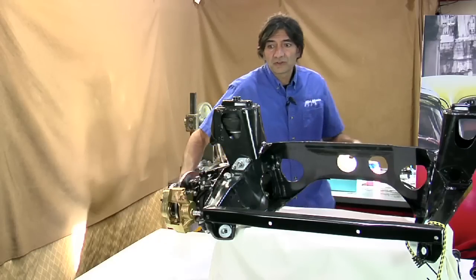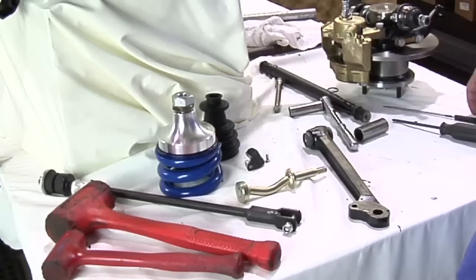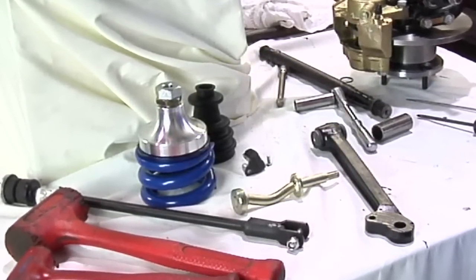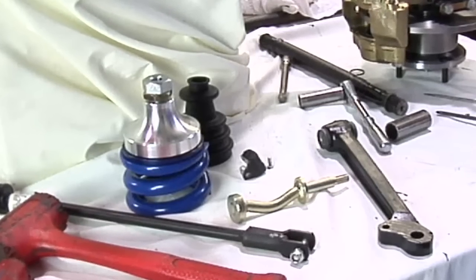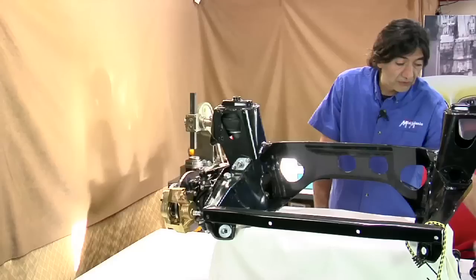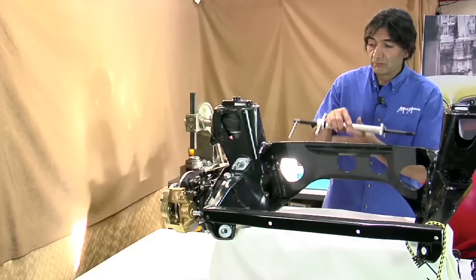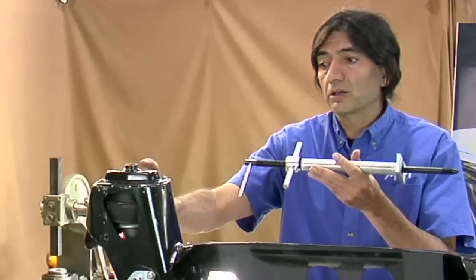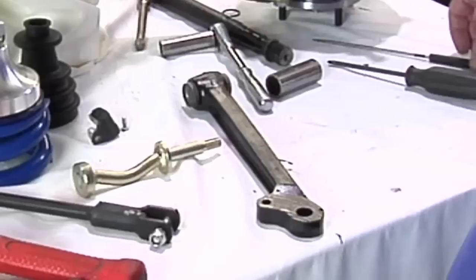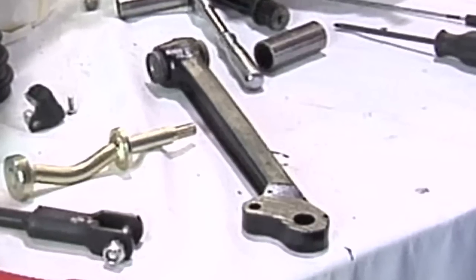Let's go over here and look at our setup with the two of them. This has the rubber cones with the stock cast trumpet piece. On the other side we have a set of coil springs and some of the adjustable trumpets known as the high-low style adjusters. We'll assemble those to the frame as a demonstration of how that style of spring goes together. The rubber cone type dry springs will take a spring compressor on the front — there simply isn't room without compressing the springs to put the trumpet in and engage the upper arm. The upper arm uses roller bearings; it's very stout.